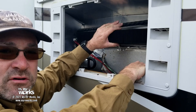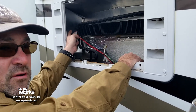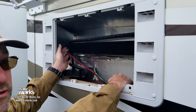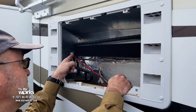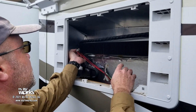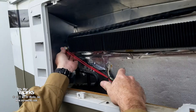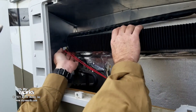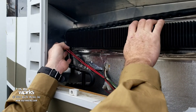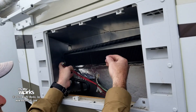If your refrigerator is in a slide room, you must have fans. This refrigerator has two fans just down below about right here. This right here is going to be your fan thermostat — it turns on at about 130 degrees and turns off at about 105. It's going to be on this fin and that's what turns your fans on. We were here the other day, tested the thermostat, the thermostat was bad but the fans do work. To test it, just touch these two wires together — needlenose pliers work. If your fans are working, this is really hot over 130 degrees and it's not working, there's a good chance that thermostat is shot. We've got a new thermostat on here so we know that part's working, and now we are going to put the flashing on.